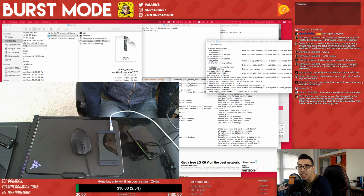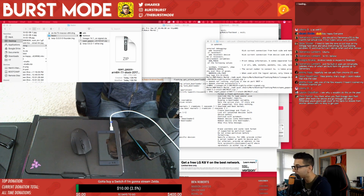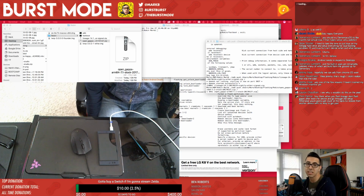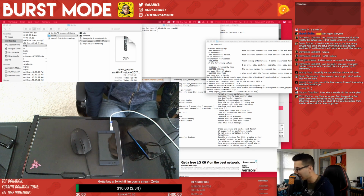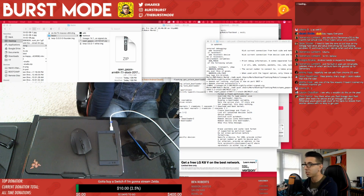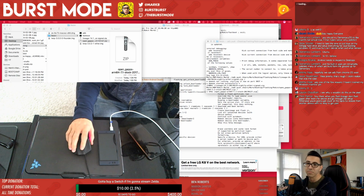Oh, really? Thank you, Chris. Is that just a bug, or should I have known that somehow? Thank you. That's really good to know. Okay, so we're just moving the stuff to the device right now, and Chris says let's not flash GApps immediately. We should boot the device first and go through the setup, because otherwise we're going to get stuck at the tap and go phase, which is no bueno, which is Spanish. But not good.